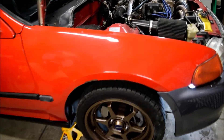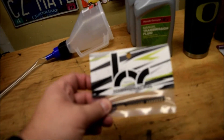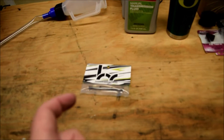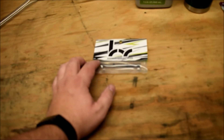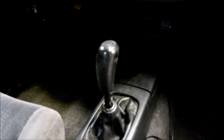I got the car jacked up, got my light for you guys. So in case you haven't heard of these — detent springs are in the transmission, I'll put a picture up right here. It's for the selector arm and there's a ball bearing that sits at the end of it. When you go into gear it will push up to lock it in place. On this car everything's stock, but when you go into gear it'll feel a lot more notchy.